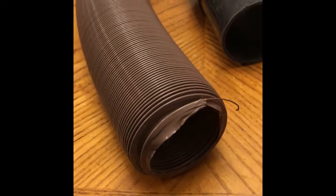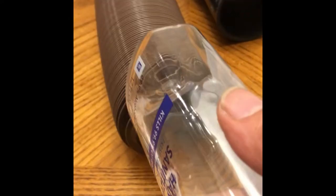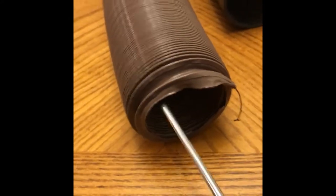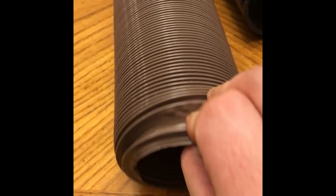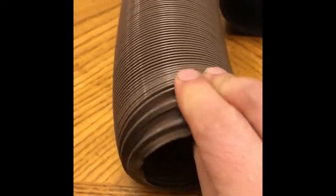Once you have that, I stuck something which was a bit big and jammed it into the hose, because what you have to do is flatten out these first couple of rings here. I jammed this in here, put a couple other screwdrivers and other things in there, and then I took a hairdryer and hit it with a lot of heat to flatten out this section.